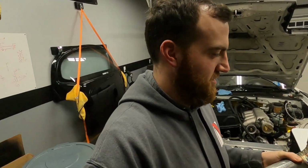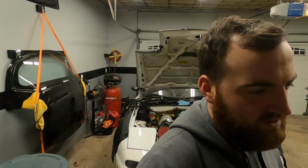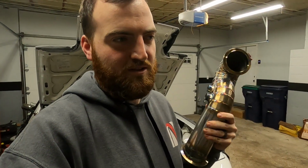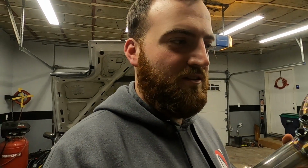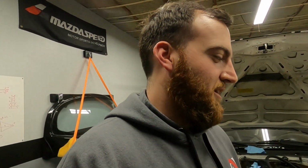My issue, mostly on aluminum, it's a little harder, is consistency of when you put the dab in, you got to feed a certain amount of filler every time, or otherwise the puddle's too big or small. Stainless seems a bit easier on that. It's probably because stainless welds slower. At least the temperature that I weld aluminum at is faster. So you have more time to think about what you're doing, and you can feed it and watch it. So I like aluminum because it's faster.